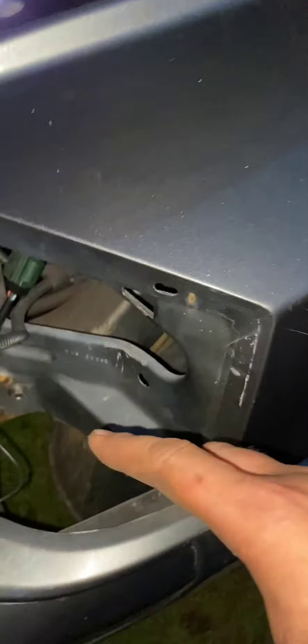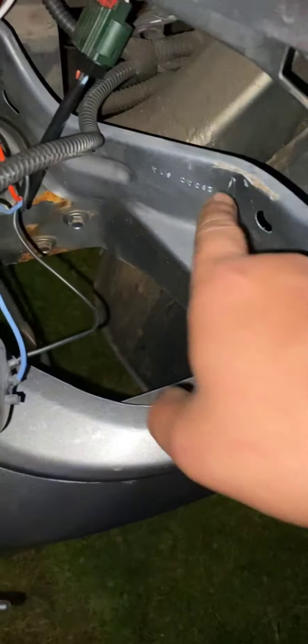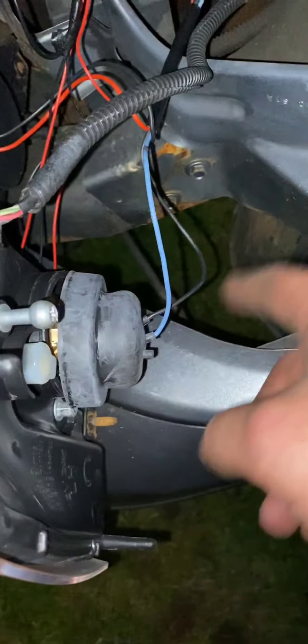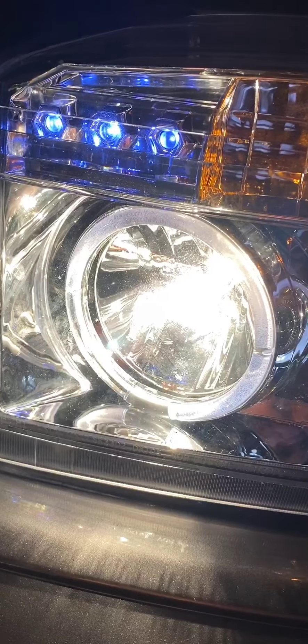I figured it out — I didn't pound this in far enough. And even though there's rubber on there, somehow when it gets pressed up against there it would cause it to ground out. So you just need to whack it in further, or it needs to be cut out. I'm thinking I'll just cut this out later, but give it a good whack and dent it in right there. These will get on that and ground out — they should have been thinking but they weren't. At least I know it ain't the bulb that failed — it's just grounding out. Could have been bad, could have hurt the truck, could have blown fuses.